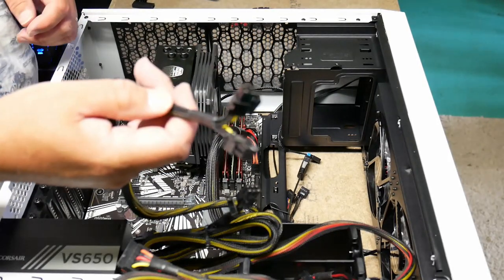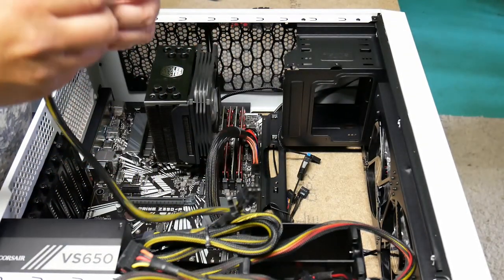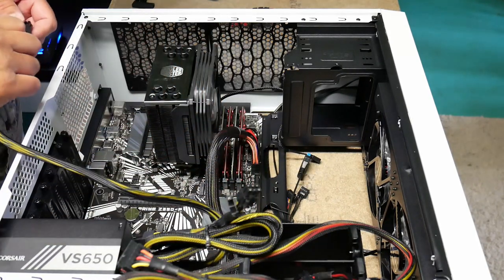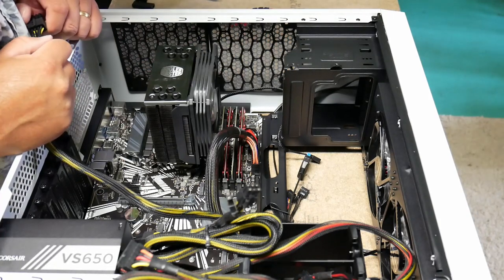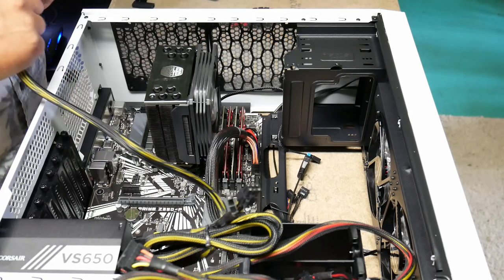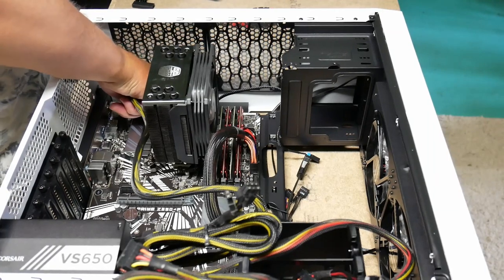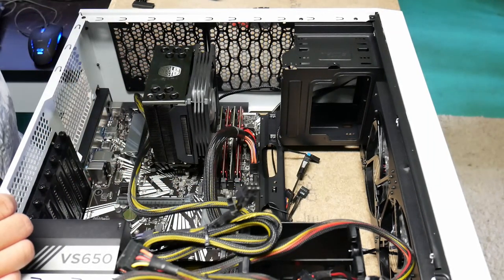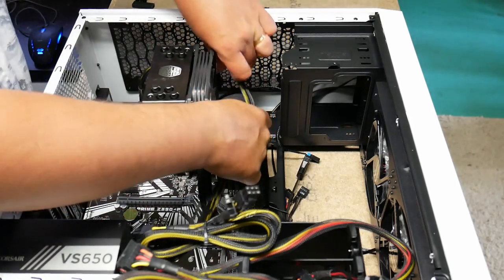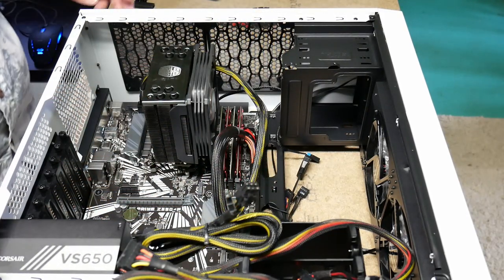And then you need CPU power, and this is going to use an 8-pin configuration. So in this power supply you need to actually connect these two connectors together somehow. There, so they click together. So then I can... Oh, here it was. I orientated myself. Oh, there. I turned the case around, I lost orientation. Anyway, so that will go down to there, and clicks on, make sure it's seated properly. So okay, that's main power for the motherboard, and main power for the CPU. And I have to try and do some cable management. Oh, it's so much pulling around.